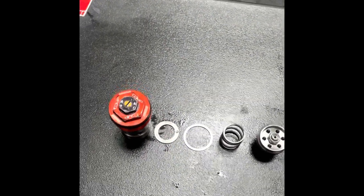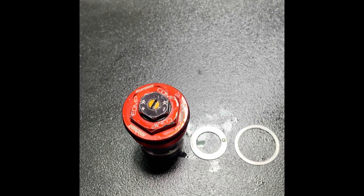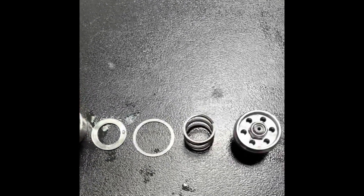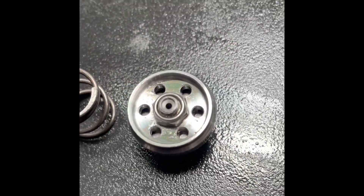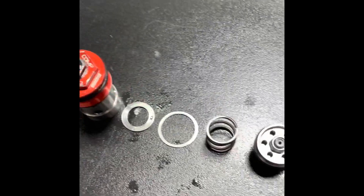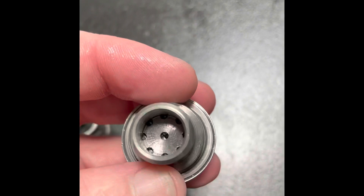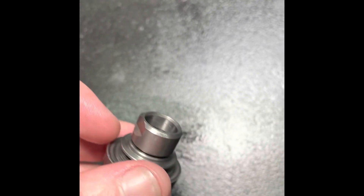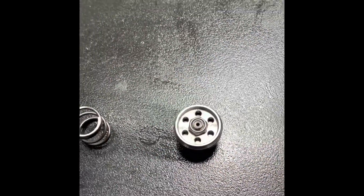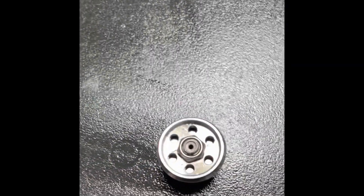This is the A-Kit compression adjuster from Showa. The most notable thing you will see is how big in diameter it is, meaning that it has a very big piston — this piece right here. The coolest feature about it, though, is that it features a sub-valve inside of it — that would be this piece right here with the holes going around the outside. What this means is it allows us to control the bleed bypass, which is controlled by your compression clicker, with a shim stack as well.